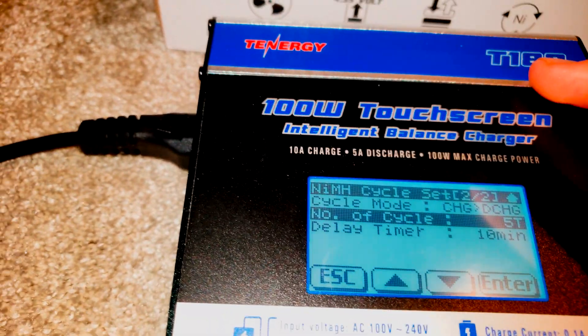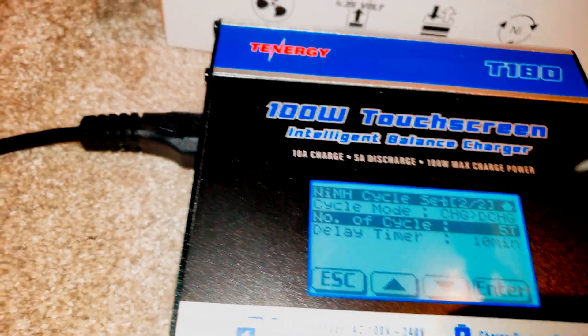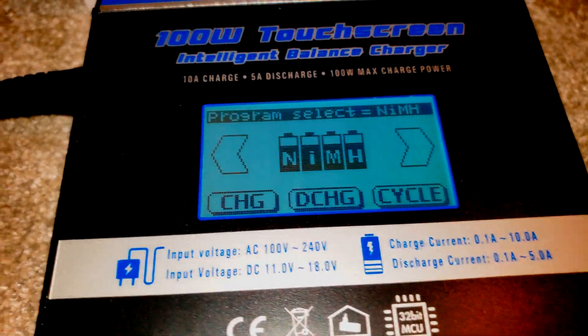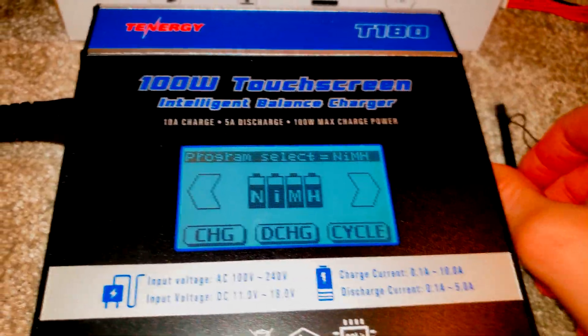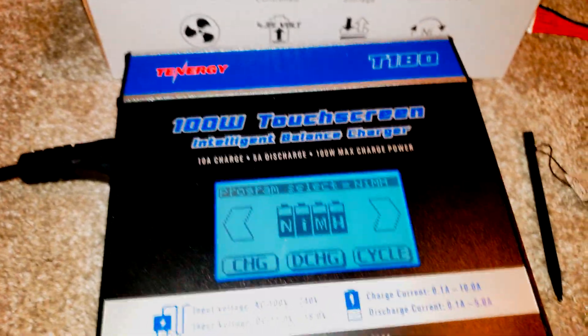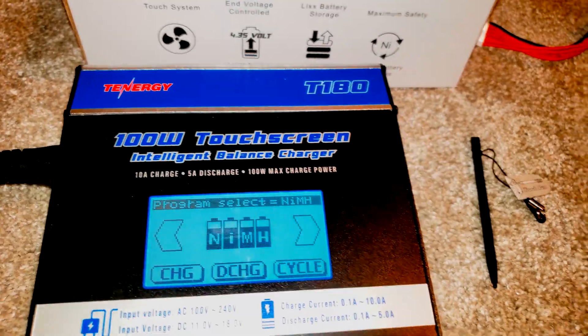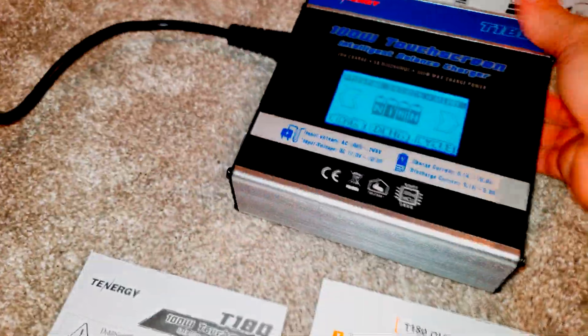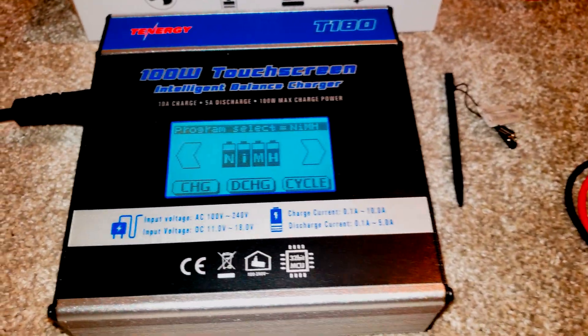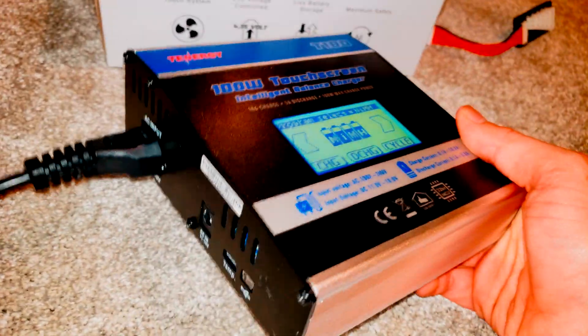So that's exactly what I did for my settings on this charger — pretty simple for reconditioning a hybrid battery. I actually had two of these when reconditioning the pack because it does take quite a while. You're limited to one battery at a time since it only has one output channel. Each individual cycle took about an hour or two, so three cycles means three to five hours depending on your battery's capacity.